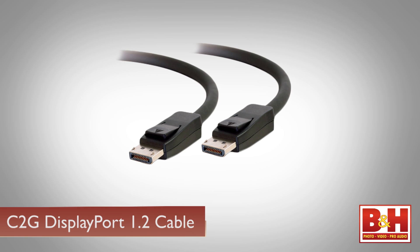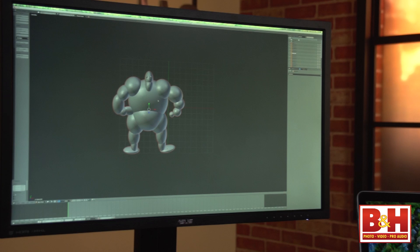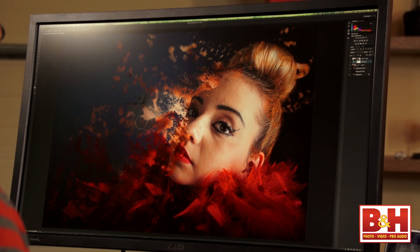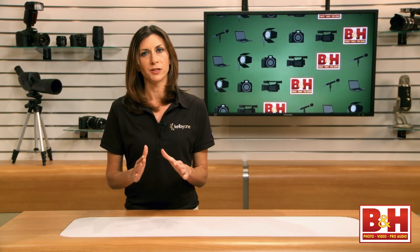To get 60 Hz, you'll need to make sure your computer can support a DisplayPort 1.2 connection. If not, you're back to 30 Hz with an HDMI cable. One other thing to consider is the panel being used. ASUS used a twisted nematic panel instead of a more modern IPS panel. Many consider the older TN technology bright but limited, especially for artistic work. If you view the monitor from wider angles — say, placed above your keyboard and looking up — you'll notice a small amount of color shifting. The shade of colors will look slightly different than when viewing the monitor dead on, and I found it noticeable when viewing footage from wide angles to the left, right, or above and below.